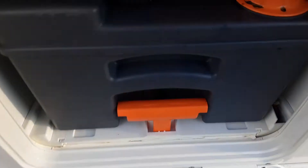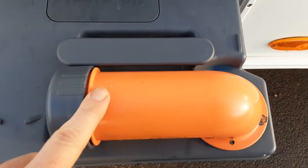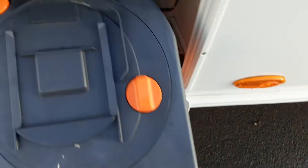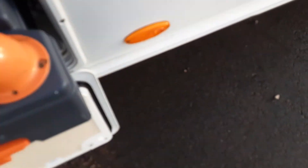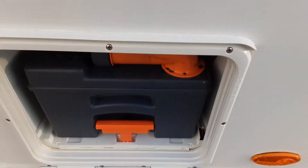At the bottom you have the toilet waste cassette. To release it, pull up the handle and pull it towards you. The neck turns out so you can empty the waste, and you've got your orange pressure-relief button on the back of the cassette. Before use, put in one litre of water and a capful of blue fluid through the cap.